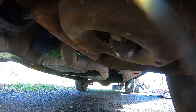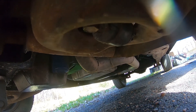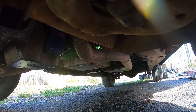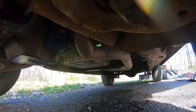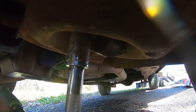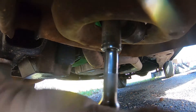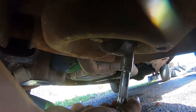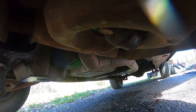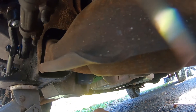The bottom isn't really all that hard - it's just two bolts that you're gonna be removing. That is a 13. I'm just gonna make sure I'm turning it the right direction. You may have to spray with PB Blaster - mine I didn't because I'm from down south, not up north. I'm just gonna go ahead and remove these bolts and then drop this out.